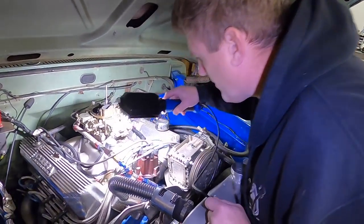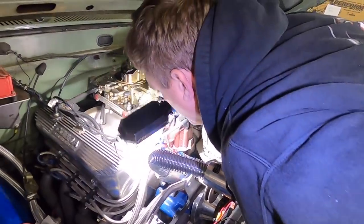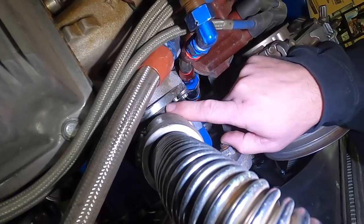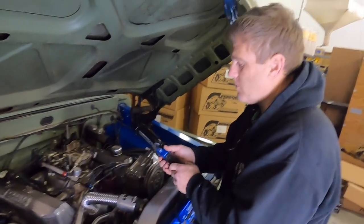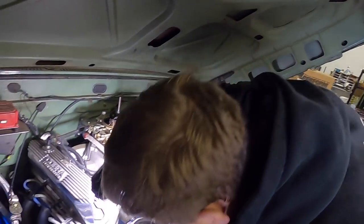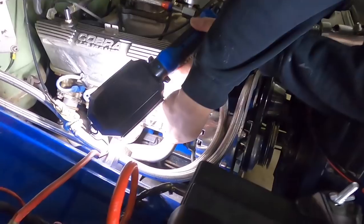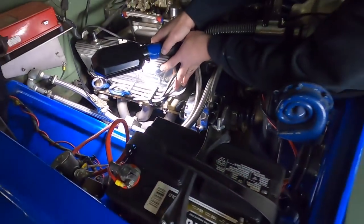So the summary so far: we'll check for oil leaks from pumps, coolant gaskets — we definitely need a new thermostat housing. If you look at it, you can see the housing is warped, which is why it's leaking. The thermostat may also be slightly out of place causing it to bind and warp the housing. We'll replace that housing. We should also probably do valve cover gaskets — you can see you've actually got oil leaking onto the head right there, right where the header bolts are.